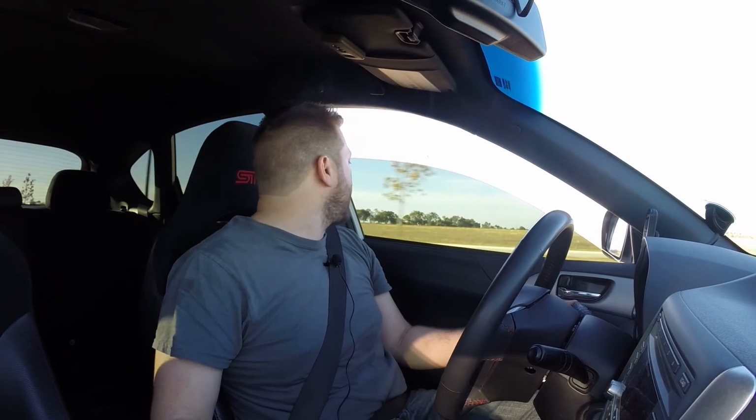I have let the car warm up for just a second here, and you should already be able to hear how much louder it is. Let's do a pull here. It's not as loud with the turn down, honestly, which is a good thing. I think a lot of it was just the echoing that was coming off of it, blowing out and just running right into the bumper area and just collecting in there. That's never a good thing for hot gases, just to be hanging out by plastic.